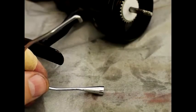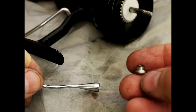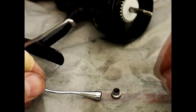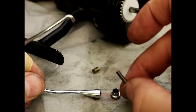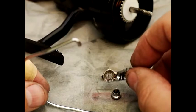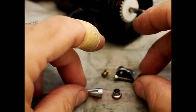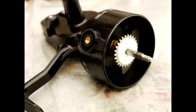The bail arm assembly comes apart like so. There's a very hard bit of metal which is a tungsten sleeve, or it used to be anyway, and there's a brass sleeve there, and there's another screw which goes into this part here. It's all pretty easy to put together. When dismantled you've got 1, 2, 3, 4, 5 parts. That's your bail arm removed.